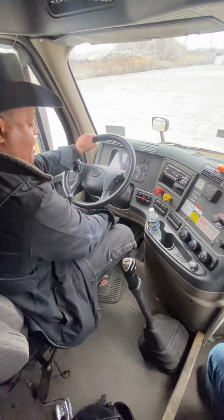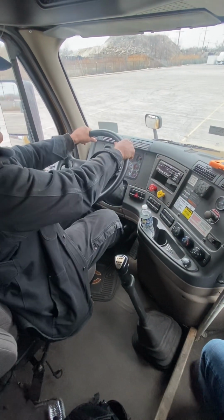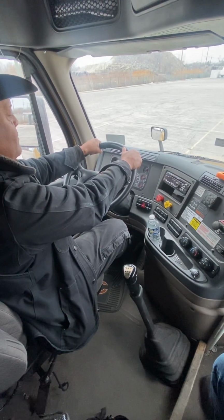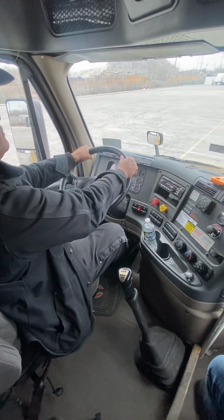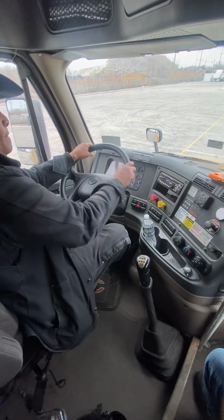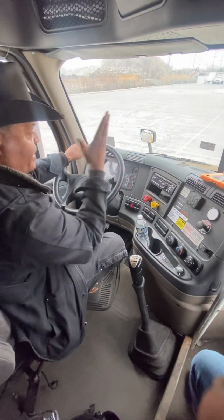This time we're going to cover service brake. Release tractor, trailer brakes. Tell the examiner I'm going to hold my hands loosely and I'm going to roll up about 10 to 15 feet. Here we go. Clutch in, brake. Set tractor and trailer brakes. Take it out of gear. Foot off the clutch and the brake. Tell the examiner this test was successful because my combination service brake stopped us in a straight line.